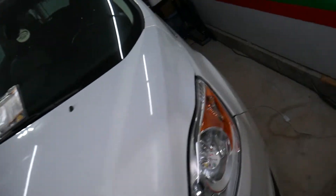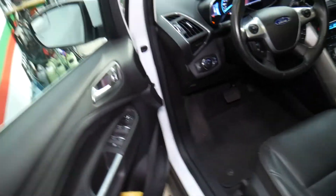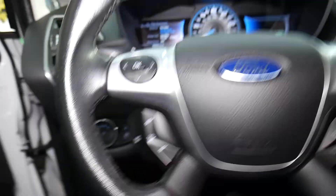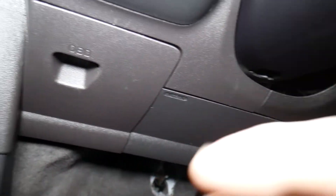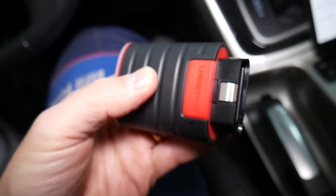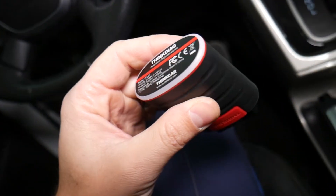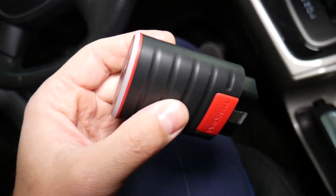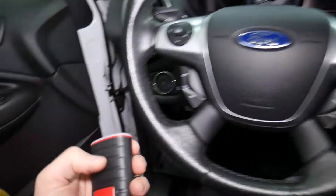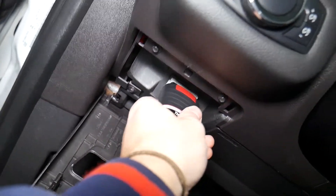With that said, let's explain what we have here. Specifically, this is a Ford, but multiple vehicles use this design. This is actually the plug-in hybrid, so I have it running on electricity to warm us up — it's pretty cool in the shop today. You need to find your OBD port — that's where you connect the scanner. Ours is under a cover; often it's under the dash somewhere. It looks like a diagnostic port. The tool we'll be using is amazing — I'll put the link in the description. It's almost like dealer-level equipment in your pocket. You can do programming and access every computer system in your car. Modern cars can have up to 50 computers; this Ford probably has close to 40.